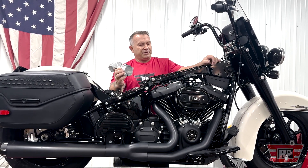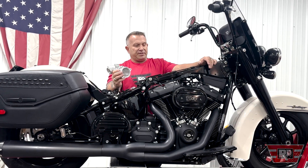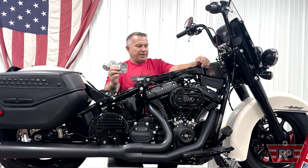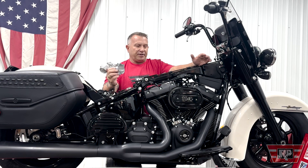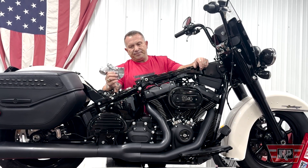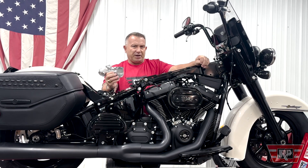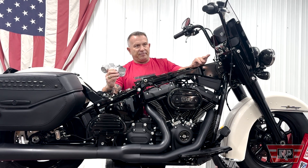This all comes finished. Here at Backbone, what we wanted to do with their bike — we did some testing. This is a stock 114. We directly put this onto the bike and then tested it to see what kind of power gains we got. Just a couple, two or three percent increase without any tuning. Then we put a CAN bus tune from Vision onto the bike and tested it against the stock one, and we picked up about four to five percent gain in horsepower and torque — just a direct bolt-on with just a base tune, nothing finely tuned.